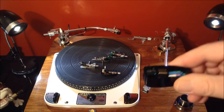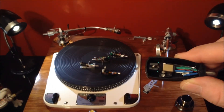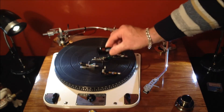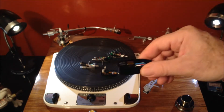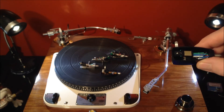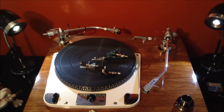There's one drawback with the Grado cartridges that I showed you earlier — they tend to pick up hum. They have coil windings inside, and if they get near a motor, particularly on an older-style turntable, they will pick up some hum. That's why I have other 78 cartridges as well. The overall sound of the Grado is really good on 78s, but it does pick up hum. I've tried them on my other decks and you pick up hum just the same — it's not just because that turntable is 50 years old.